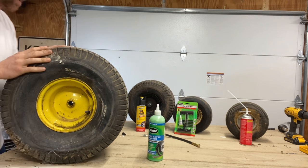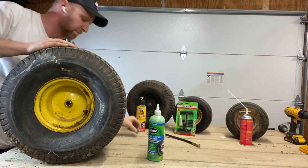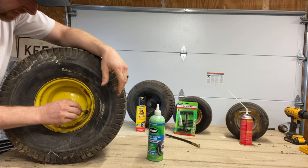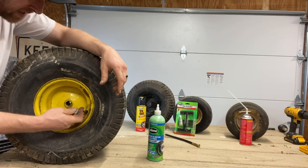The first step is to remove the valve stem. The tire slime bottle comes with a little valve stem remover — they do work but they're plastic. I like going to AutoZone, a little $2 valve stem tool. I have wrestled with these so many times. This tire slime trick works probably over 50% of the time. If it doesn't work, then you just go to plan B — either try to get it off or just use a tube.